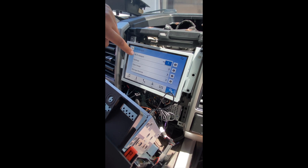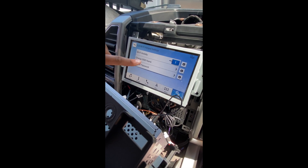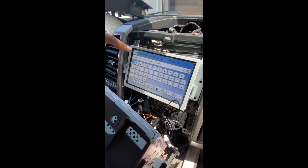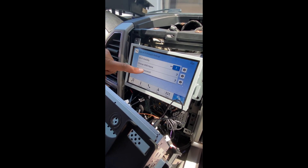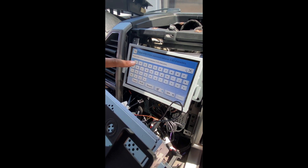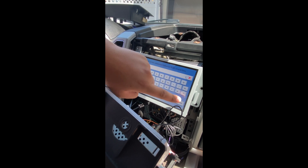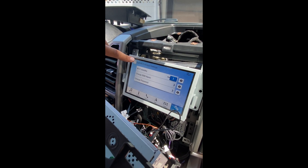Go to Vehicle Hotspot, make sure the hotspot is on, then go to Settings. Go to Edit, change the SSID name to whatever you want, then hit OK — it'll say successful. Go to Password; I like to make the password 12345678. Hit Done, it'll say successful, then hit the back button.